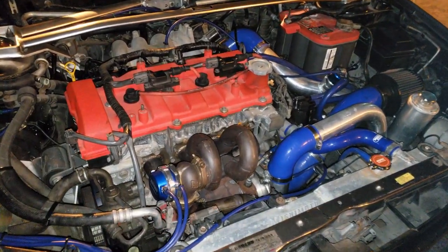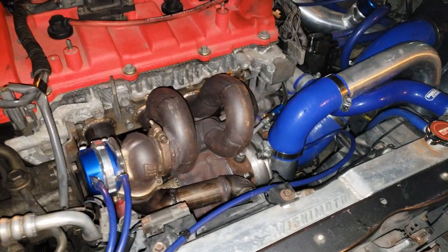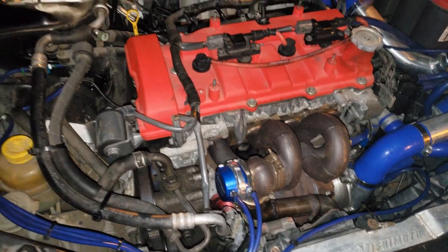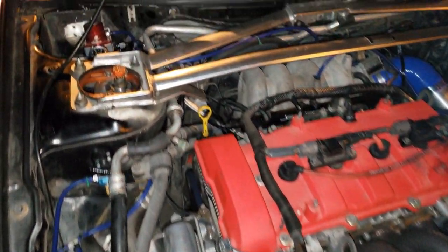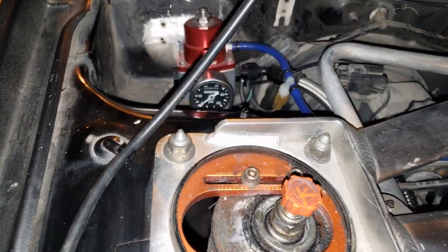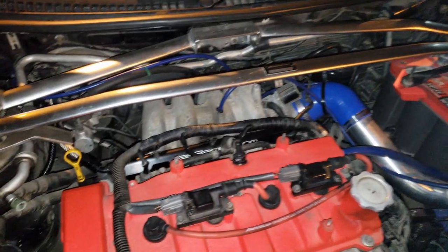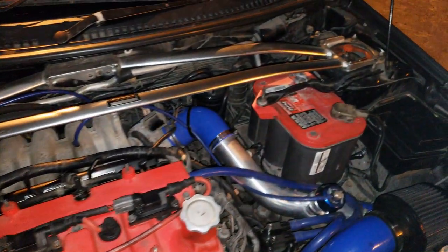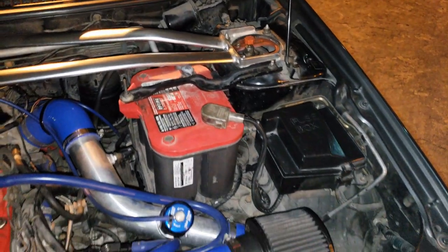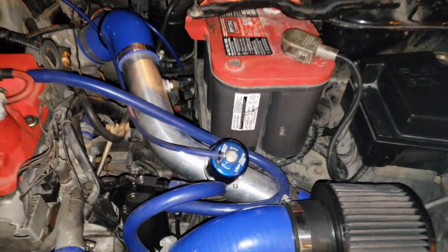All right. Just on average, how much horsepower is this car on, or how much is it rated for right now with the turbo? Right now, it's on wastegate power of, let's say, 12 pounds. So on the 12 pounds, it's 220 horsepower, 228 foot pound of torque. My goal is actually roughly around 400, but how the car is performing at the 220, I might just mellow at 300, because it's a very, very fun car to drive, especially on cornering,